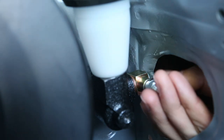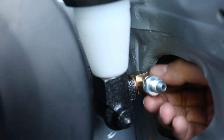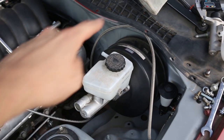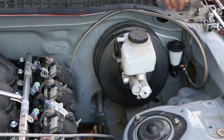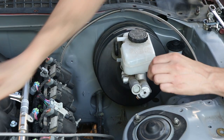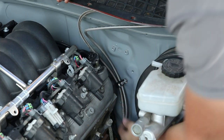Now I've got to figure out where I want my clutch line to be routed — do I want to go up from above like this, from down below, or just straight on? It's really just a matter of the best way to route my clutch line through the engine bay. The line is super long — it goes out from there all the way up, over, and down to the slave cylinder. Right now I have it tucked under this little metal bracket, and then it'll run up here. I also need to figure out what to do with my bleeder for the clutch.